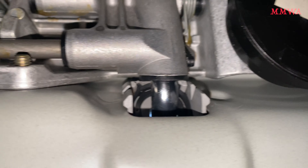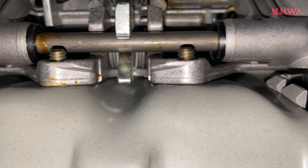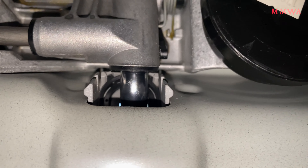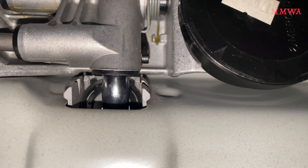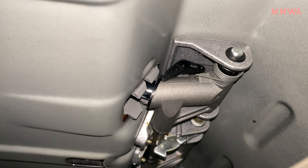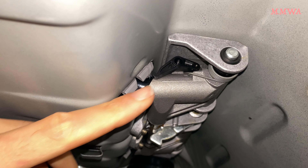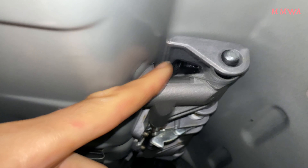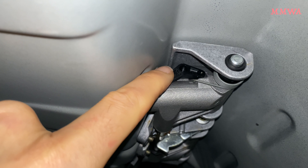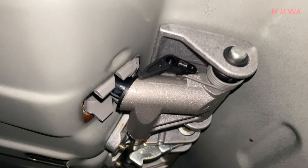This is the backside of those plastic covers. As you can see you have full access to those clips — there's no need to put their lives at risk by prying from the top side if you can get into the rear. I just used finger pressure; it can be quite annoying but they do come out this way, and then you pretty much guarantee their safety. This is the locking mechanism as well, which is accessible from the top once those covers are removed.